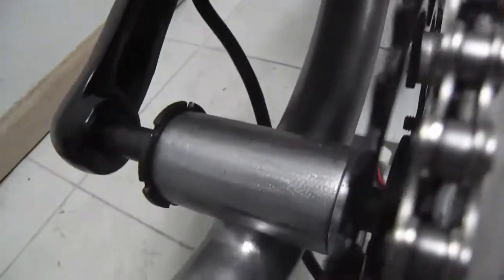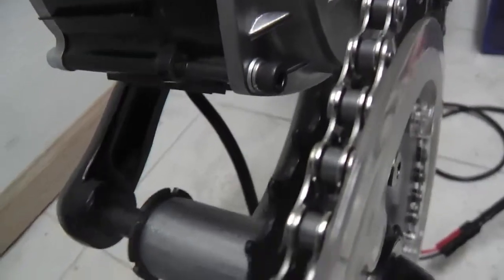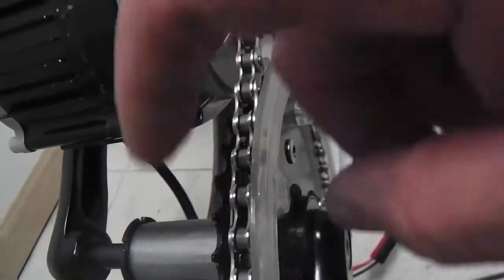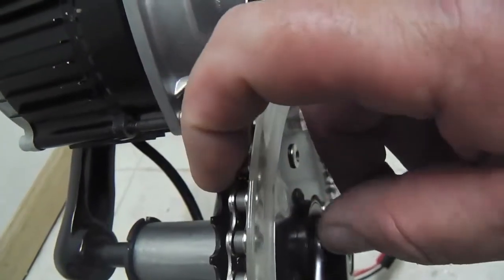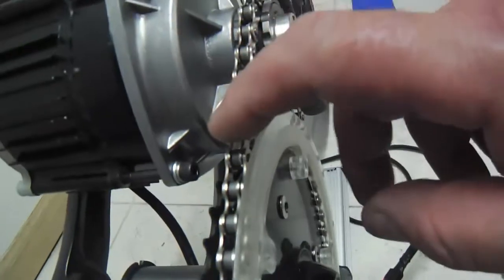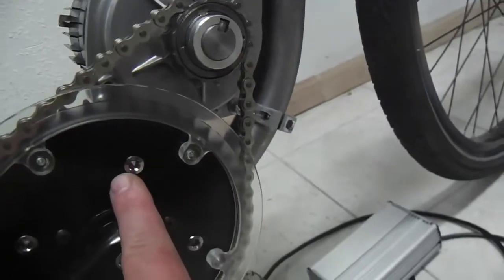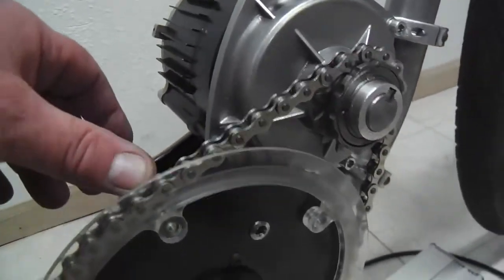in the installation. And one of the finer points, I believe, is these two sprockets right here. One chain is a 1/8 chain, and those two sprockets are quite close together. And if you've got the 1/8 chain and you put the other one for your final drive, they could clang and chafe on each other. So I'm thinking that maybe if you're going to stick with these same two sprockets, use the 3/32 chains instead of the 1/8, or put a washer at each point of these spacers here. In between these spacers, there's a spacer, and you could create a little more space in between those by putting washers there.